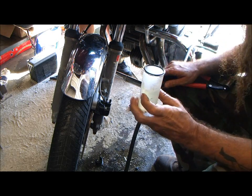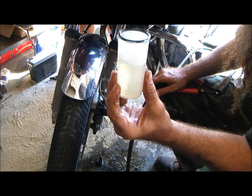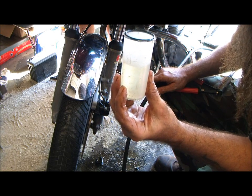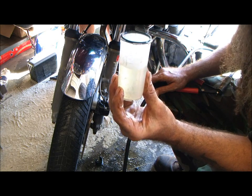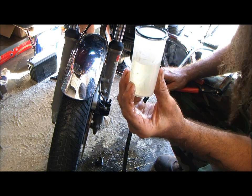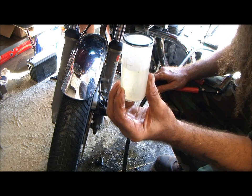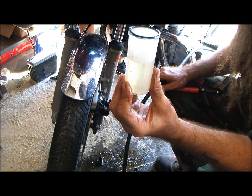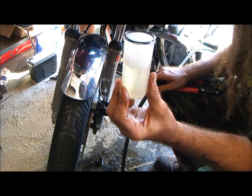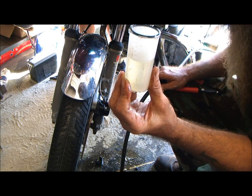Alright, I'm going to cut this video short because we're way over time here. But when it comes out clear like this, I don't give a shit what you do, but I kind of do because I'd like to see you stay safe. Just because it's clear like this doesn't mean that you got all the shit out of there. You stop, you wait about 20 minutes, you know, smoke you a few cigarettes, do whatever you do for time. Come back, pump it again. If it's still clear, you don't have to do it no more. If it is not still clear and you're pulling more shit out, do it until you know that it is clear, and stop at the end, wait 20 minutes, check it again. If you know it's clear then, you're good to go.